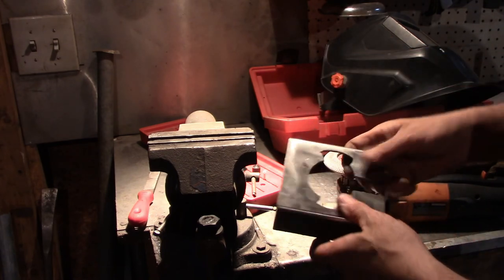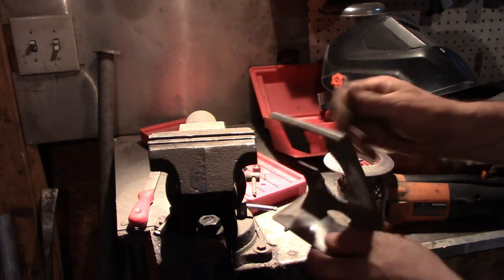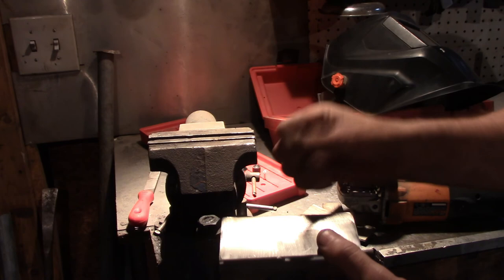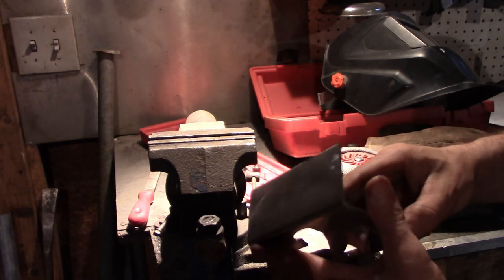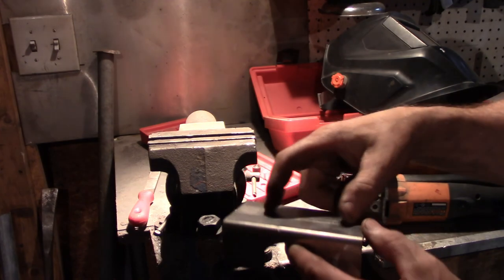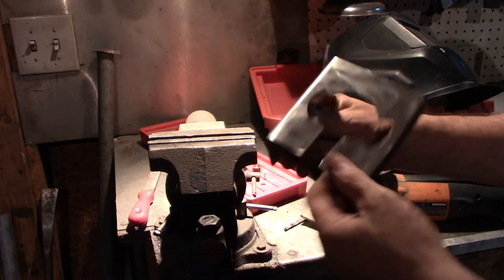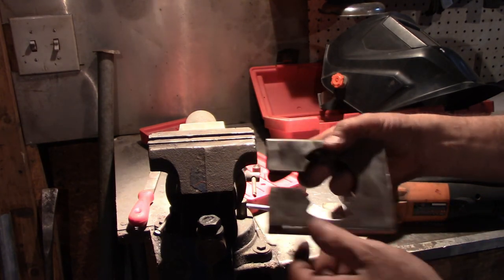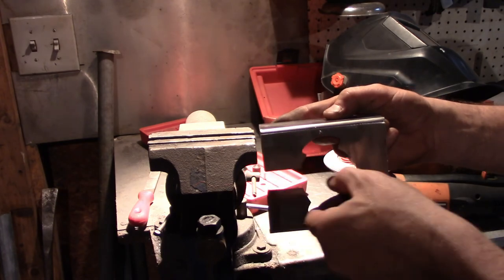Here's what I came up with — it's still a little warm. I fit it — a little dirty here but it's stainless, I'm gonna paint it up. I was gonna weld it, but this is stainless and that's regular steel, and I've got stainless wire but I'd have to change the wire and the gun. I think I'm just gonna drill some holes here and pop rivet it with stainless pop rivets. The slot is gonna have to stay because I'm not taking that plug apart — there's no way it comes apart easily without something breaking.